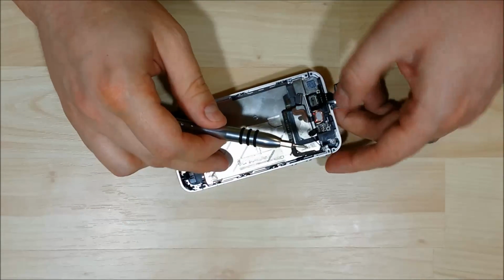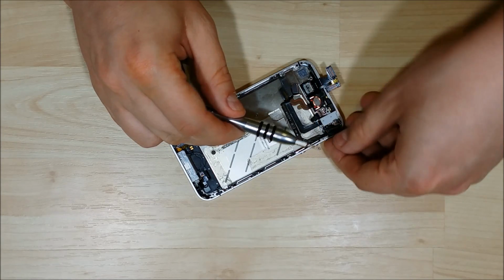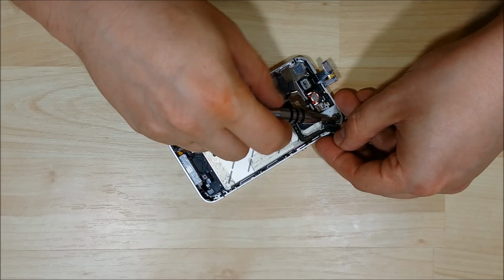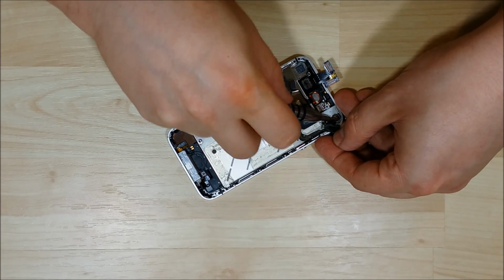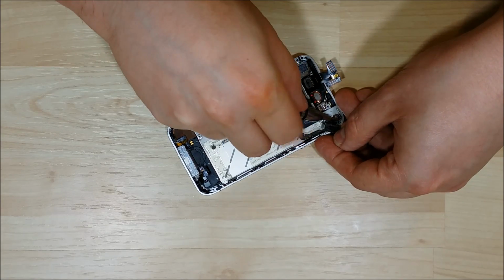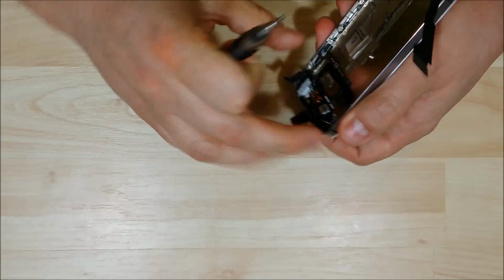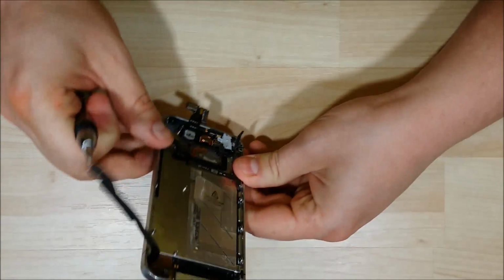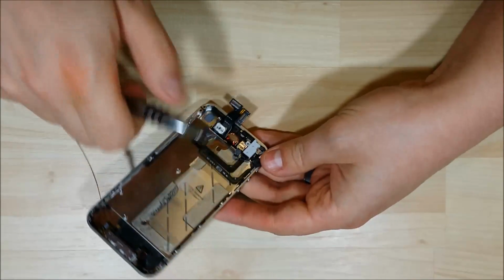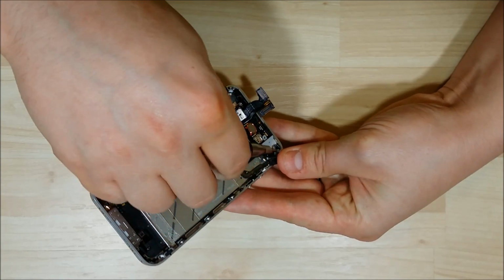This is the tricky one right here. To be honest with you, a slimmer screwdriver works a little bit better. When you buy an LCD, you usually get a lot of tools with it. I think this one cost me like 25 bucks, and it came with things like a guitar pick and a plastic puller, and a few of the smaller screwdrivers with just the flat black sides. Now I don't really like to use those too much, as I find it's a little bit easier to strip out the screws and get a lot of leverage. So I like to use this iFixit one that I have.